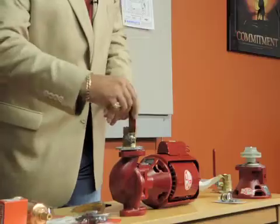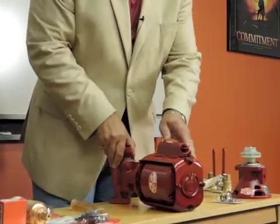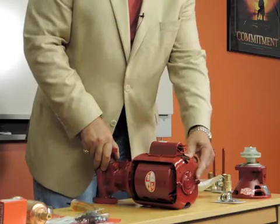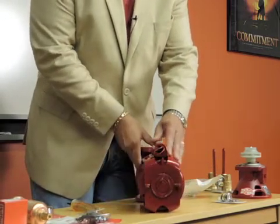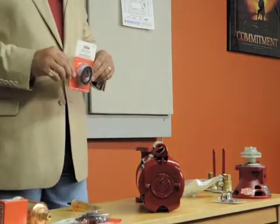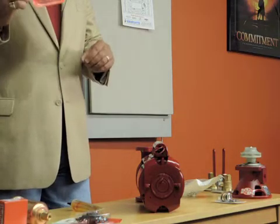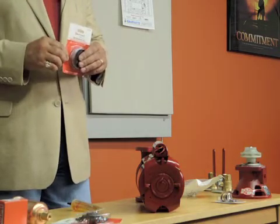Chances are, on the very end of the pump, on the motor, this area here is a rubber resilient mount — it is a ring mount. That ring mount is replaceable. It's called the motor coupler story: when couplers start to break, ring mounts sag. You replace the ring mounts, replace the coupler. There's no need to buy a whole new motor.